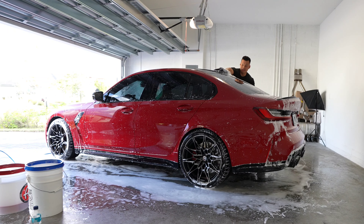It still hasn't hurt the ceramic coating because I can still see the soap being fought off. This product is good if you use a lot of drying aids, but it also helps remove tree sap and iron deposits — especially if you park near a train station or a rail yard. A lot of those iron composites and deposits get into the air and saturate onto your paint. That's when you start feeling a lot of the roughness.